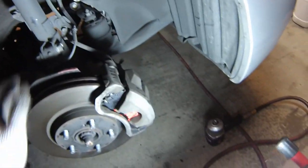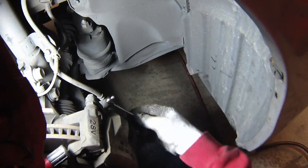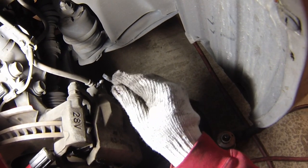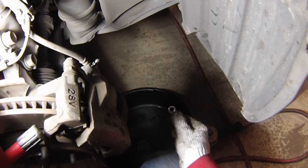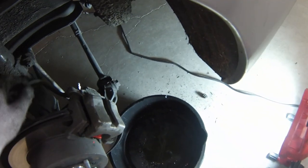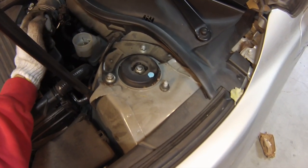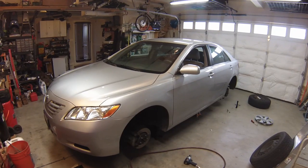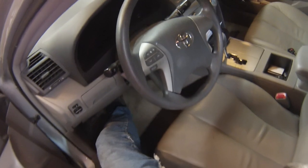One thing we'll want to do before putting the wheels on is go ahead and bleed these front brakes a little bit. If you don't have a helper, one thing you can do is a gravity bleed — if you loosen this screw, the fluid will actually flow into the caliper via gravity. It takes longer, but any air will come out and any old fluid will come out as well. Just keep an eye on things and tighten it back up after an appropriate amount of fluid has gone through the lines and caliper. We'll gravity bleed the rear brakes a little bit as well. If you are doing a gravity bleed, make sure you have the cap off the brake fluid reservoir — otherwise the vacuum will slow things down or even stop it. Be sure to keep an eye on the reservoir and top it off if it drops. One final step: always press down on the brake pedal several times after changing the brakes to make sure it's nice and firm — you don't want any accidents backing out of the garage.